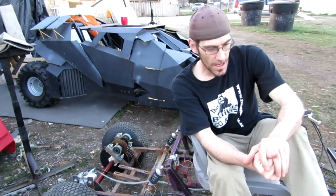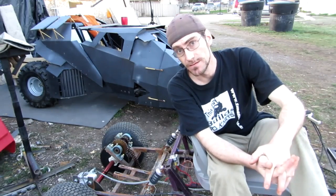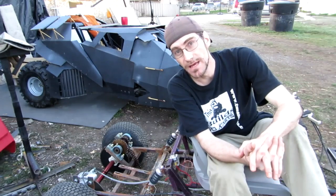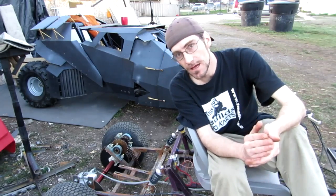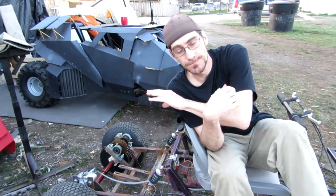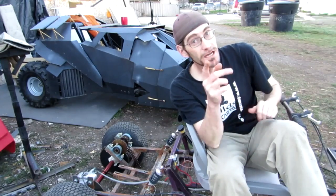I've gotten a lot of questions over the years where people say their chain is making a weird noise when they start driving and they don't understand what it is. Most of the time it's alignment. Make sure you look closely at the alignment of your sprocket in relation to your chain — everything should either be parallel or at 90 degrees. That applies to your torque converter, jack shafts, or anything else. Make sure you pay attention to alignment on all your power transfer setups, and I'm going to end this video with some romping we did on Easter Sunday.